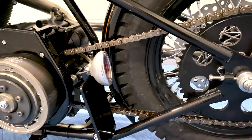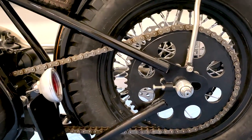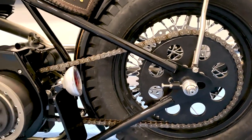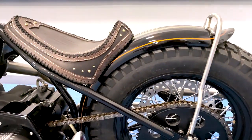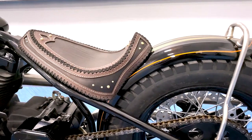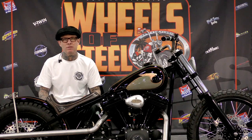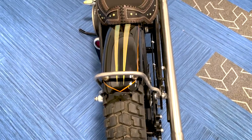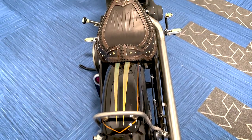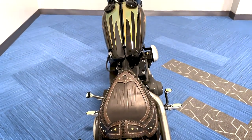This is our friend Chris Rosenberg's bike. Brian Buterres built the frame. One of the challenging parts is this is a shovel head specced frame, so the rear section — all this stuff isn't supposed to fit in here. It kind of went under the assumption when we were fabricating the bike that we'd just buy Dyna stuff and it'll all work. No — not in that frame width. But the end result, you have a slim profile rear end that you're not going to get with an aftermarket frame at all.